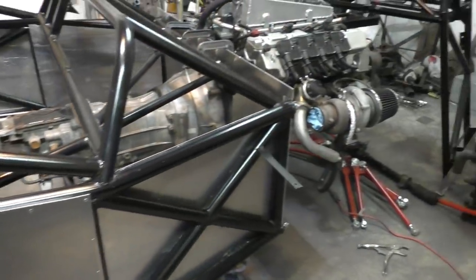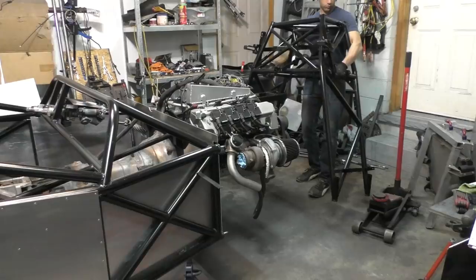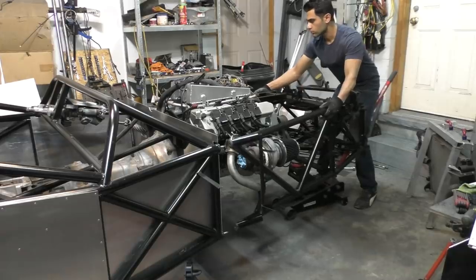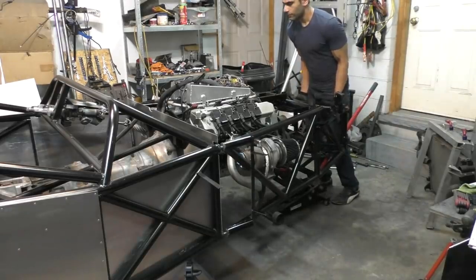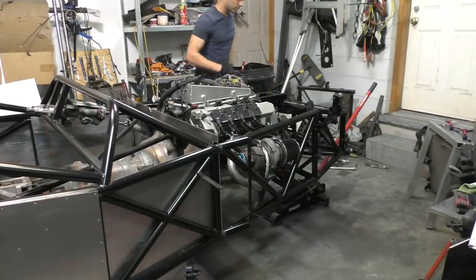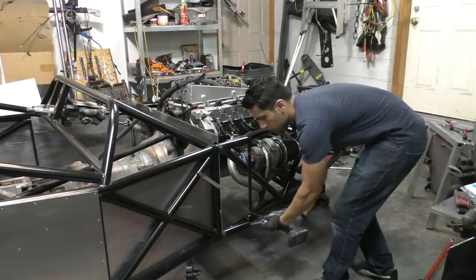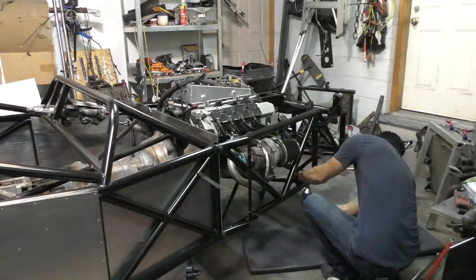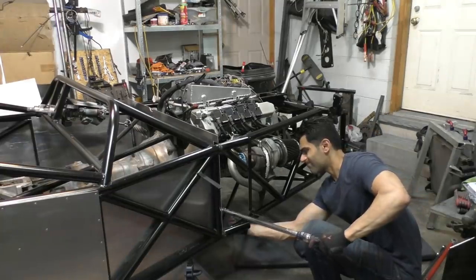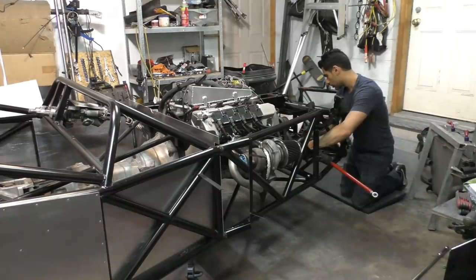Now that most of the aluminum panels are mounted, I have to get to putting the whole chassis back together — putting the front end on, the radiators, and everything. I started by putting the front end of the chassis back in place, which was a little difficult to do by myself since the bolting points have to line up exactly, but after a bit of effort I got everything bolted in place and torqued down properly. After that, it was onto the front suspension, starting with installing the steering rack.